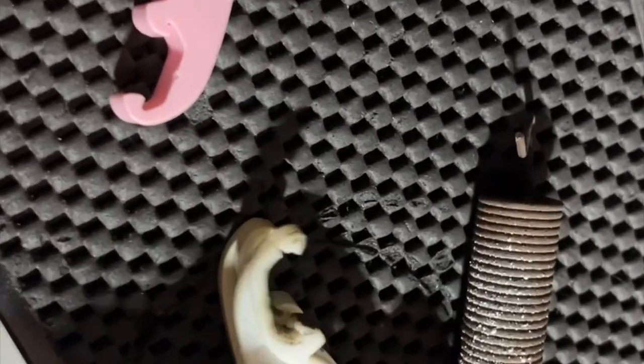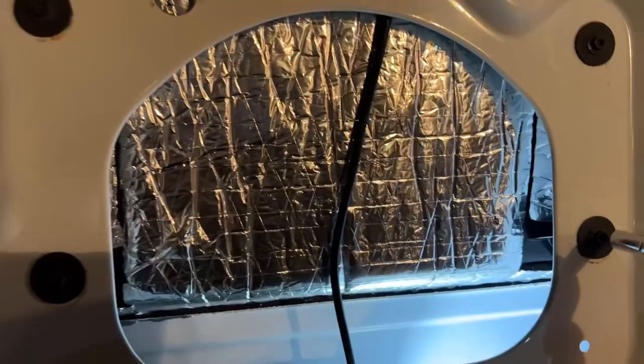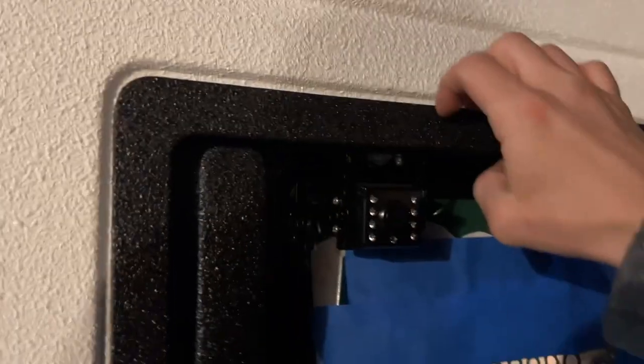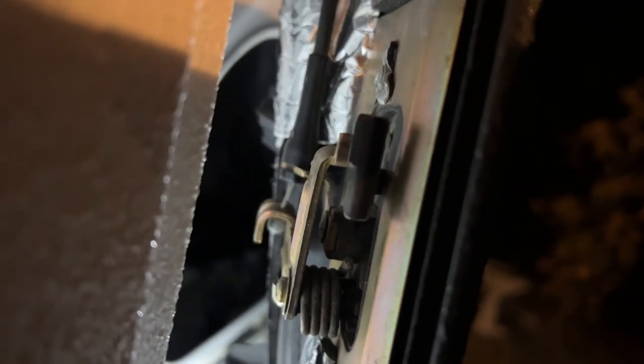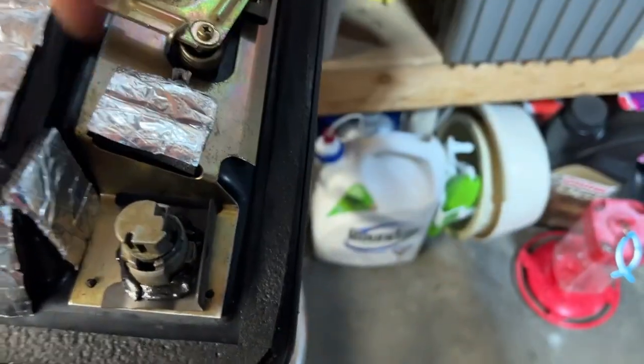The clip part appears to be exactly the same. This one was clipped onto the bottom, if I remember right. To show you guys a little better, I'm just going to remove it. This one is just four 7mm bolts, and then this piece just kind of pops out. There's a door latch which I need to remove, and that little plastic piece just pops off. There's a little ball on the cable that you have to remove as well. Pretty much all of these Ford lock cylinders just have a metal clip that you pull out this way.